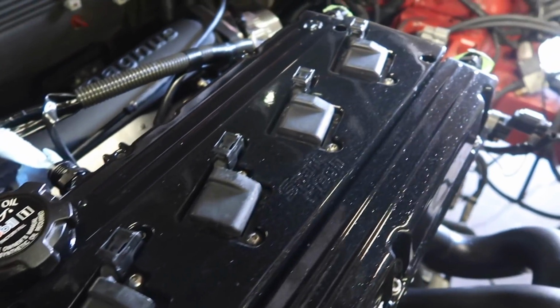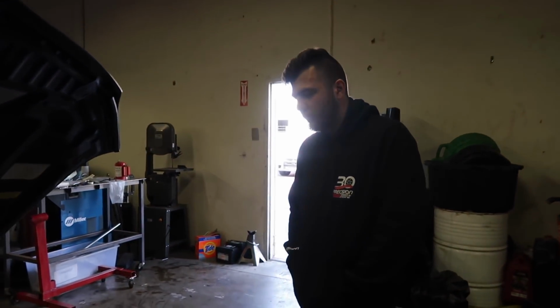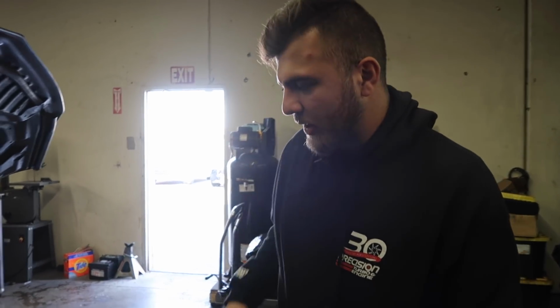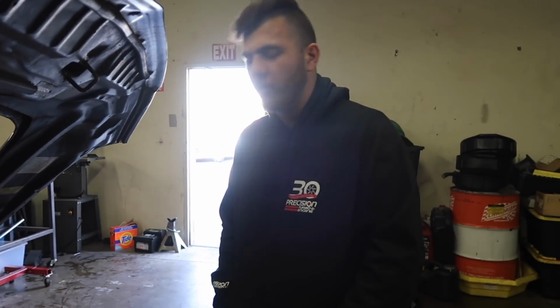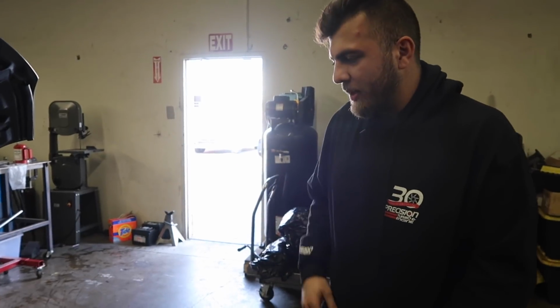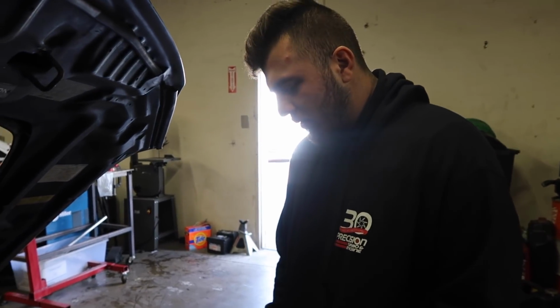Yeah, it looks beautiful, man. Magnus V5 intake manifold. It's a 5-liter plenum. 74mm throttle body from S90 that I actually had to port the adapter plate that comes with the Magnus intake manifold to match the throttle body. So stock is 60, so you know it's 14mm bigger. I could have gone with, okay, I forgot the name. They sell a 90mm one that you can slap onto this, but you know, this should do for now.